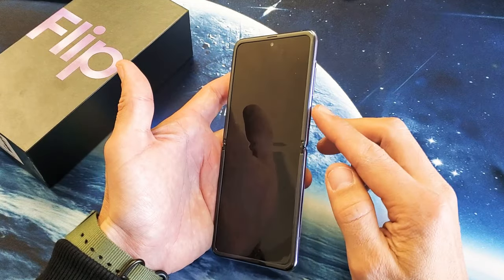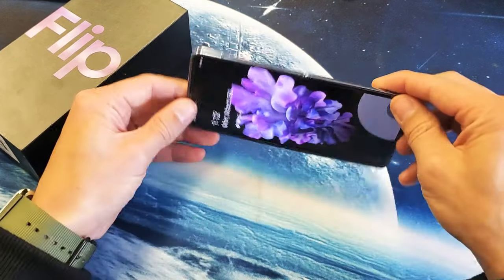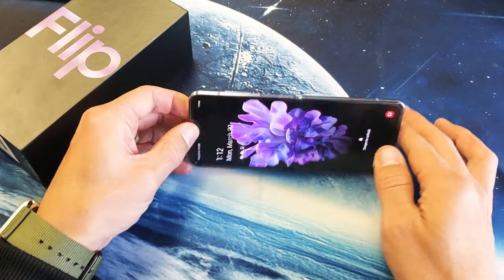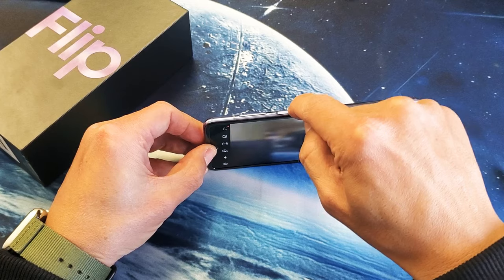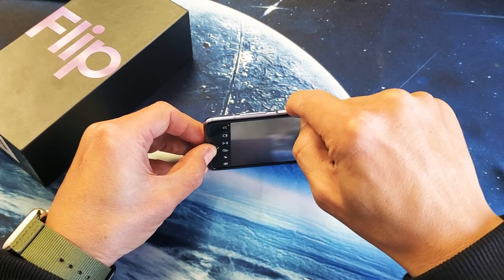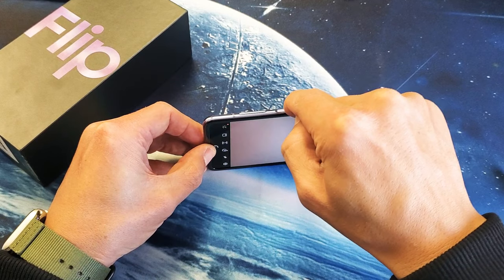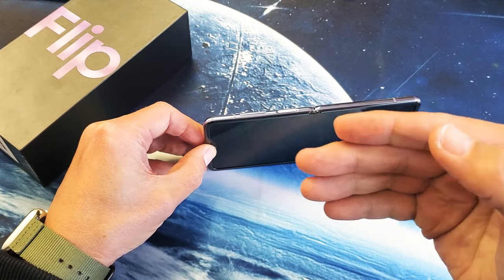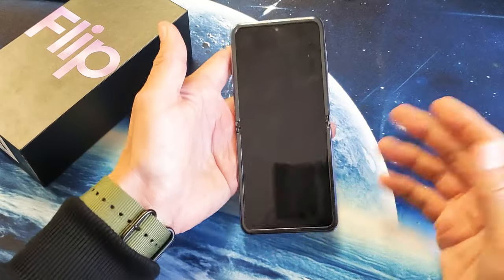This phone is actually working, but just follow my steps. The first thing I want you to do — let's pretend my screen is black — is press the power button in and out 30 times, all over the power button, up and down. Keep doing that, because sometimes your power button can be stuck, jammed, or loose, and that can cause a black screen as well.